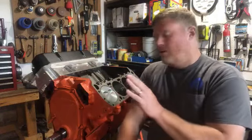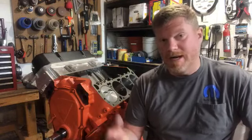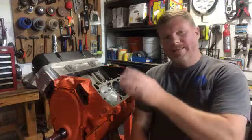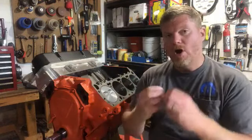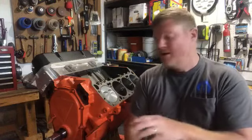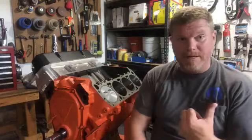So what do you do about detonation? First, believe it or not, all those additives you see on the shelves at Walmart or AutoZone, the gum-out stuff, the carbon stuff, a lot of it works. It's not just snake oil. There is some actual science to a lot of these additives. You put it in the gasoline, or it's an oil additive, but typically it's a gas additive. It's trying to break up any carbon that might be building up around the valves or on the surface of the piston, and get it out through the exhaust.